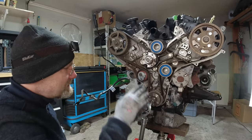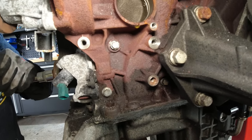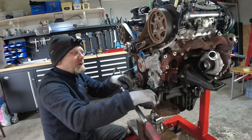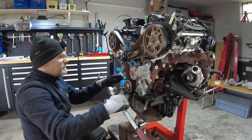Here's the interesting part - listen to this. That doesn't sound good - there's a loose rod. There is a loose rod, and that rod poked a hole in our engine block. Also, when timing is set up properly, you lock the timing via the flywheel opening - you have to take the starter motor out for that.